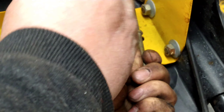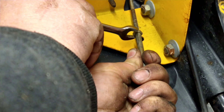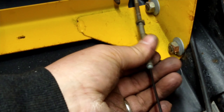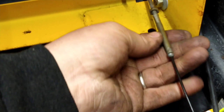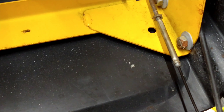So we'll hold this part by hand, take a 3/8th wrench, and we'll loosen this nut up, spin it up, and then just keep twisting it to start bringing some tension onto this cable. This thing is way out, so we'll go to there. Now there's not as much slack. Go to the cable, go to the lever, and it feels a lot better.